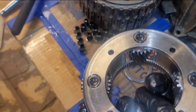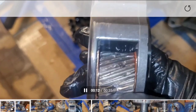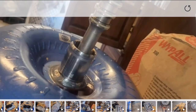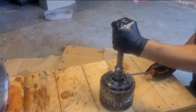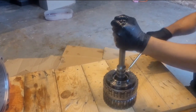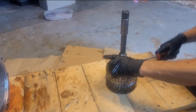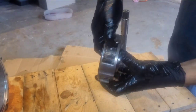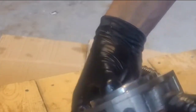Alright everybody, if you've been watching up to this point, I appreciate you watching. I'm sorry I didn't do that quickly. The next video I post will be the inspection video, where we're going to go through pretty much looking at all the parts. You can see my gear set here is just destroyed — that's the front gear set. I'm pretty sure that's the noise I was hearing when it would be in park and in neutral. Not only that, but the 4-5-6 clutch assembly housing, the input shaft — I'm going to have to replace that because it was just stuck in there and it's destroyed. So I appreciate you watching and for supporting my channel. We'll dig into this here soon.